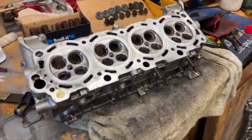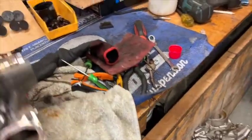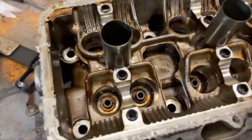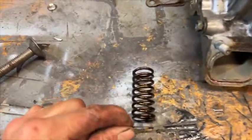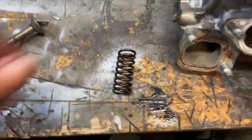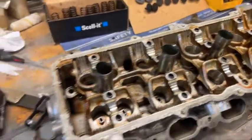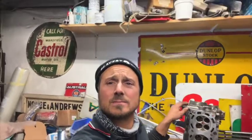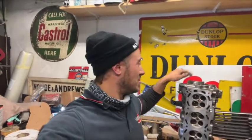We'll take them over to the head shop tomorrow. Now, one thing I will say where I've cocked up - I forgot to take out the spring washers before I cleaned it. Underneath the springs is a little washer, and that's to stop the steel biting into the aluminium. I forgot to take them out before I cleaned it, and I have now jet washed them away. I've got 26 remaining - I've got to go and find these washers somewhere around the car park. Head gaskets are coming from America - cheapest place to get them, Rock Auto.